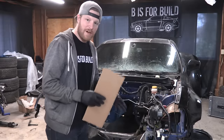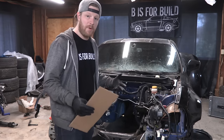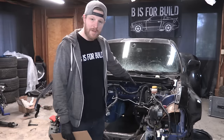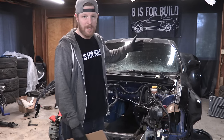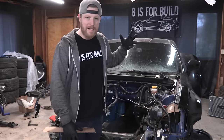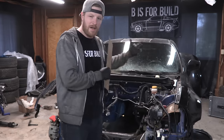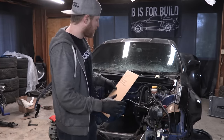To get started today, I'm going to fiddle around with the BRZ's electrical system and see what still works now that we don't have an engine in here. The game plan for this build is to do a dual ECU setup. We'll be leaving the ECU and the CAN bus system - everything from the BRZ in the BRZ - to hopefully control the BRZ auxiliaries like electric power steering, headlights, door locks, windows, those types of things. The BRZ has three different ECMs: one to manage the engine, one for the inside, and one for the rear. We're not going standalone ECU. We're trying to do this on a budget.